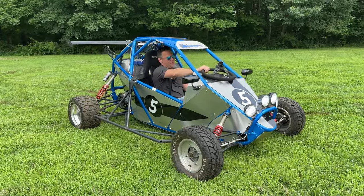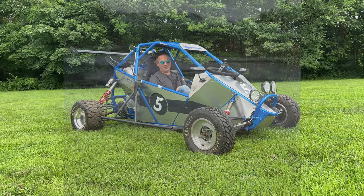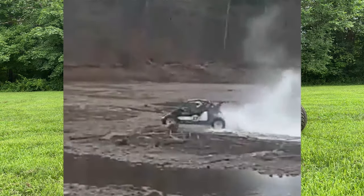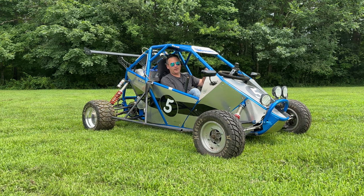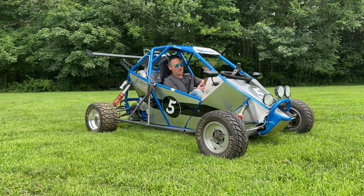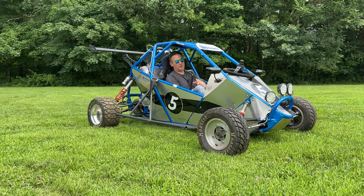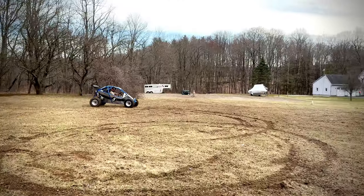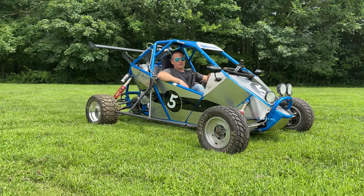As you can see, there is absolutely nothing like this. They're cross carts — not go-karts, and too small to be buggies, but you can take these anywhere. I call these VFs, or variable frame. This one is currently set up with about five or six inches of ride height and six inches of shock travel. I can take this on asphalt, in dirt, or even jump it. I do multiple shock positions and have a second set of tires just for trail riding and off-road.